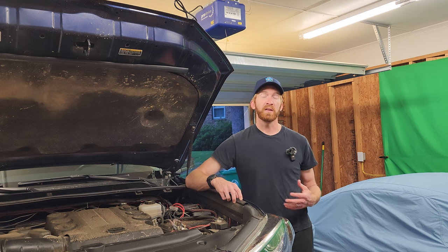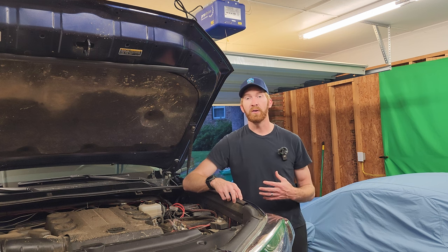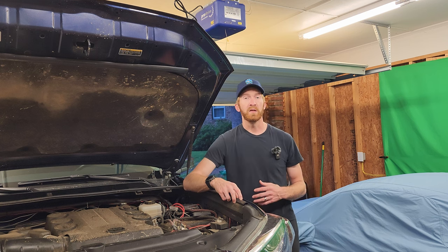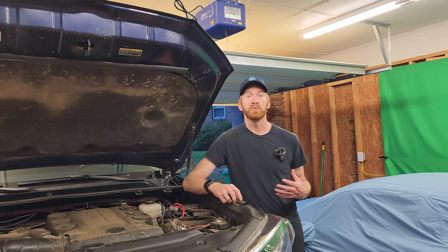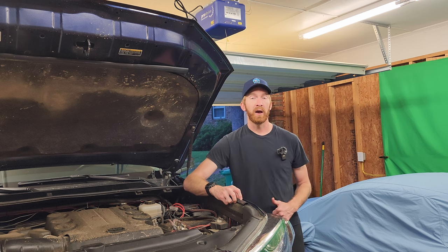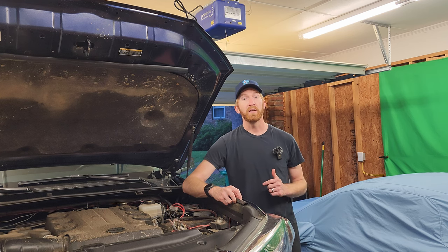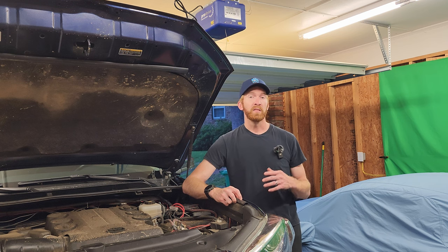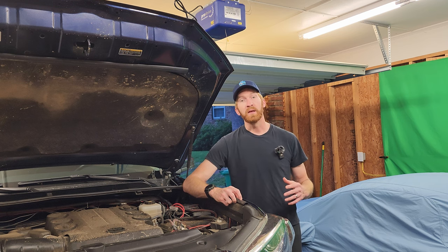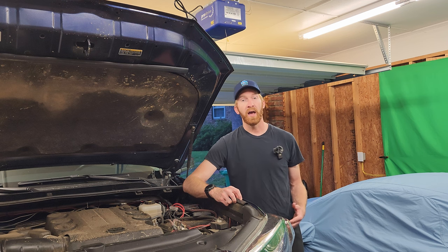Those are the three stages to show the wiring on those control switches. It's a little confusing to explain — it's much simpler in person. Have confidence that you can do it yourself. You're just going to be providing power and ground to the switch, and then out of the switch once it's pressed, that's going to go to your input. After that, it's all set up in the app. The app is super simple. As an update, I have not had any problems with the app — the software has worked every time I've pressed a button and the lights have come on. I haven't had any issues.